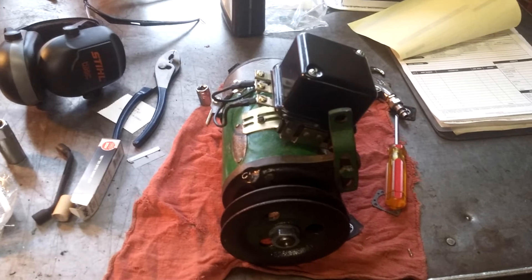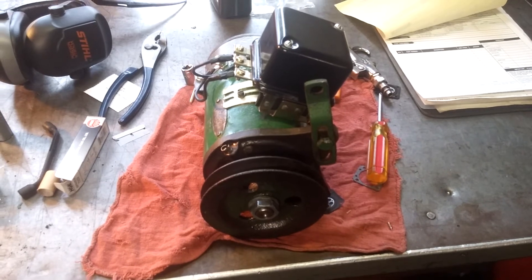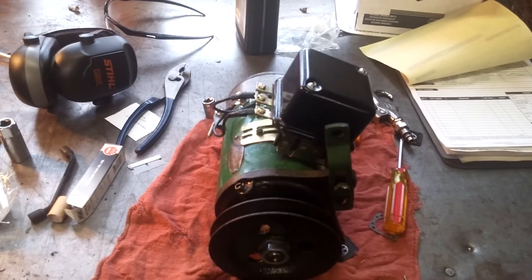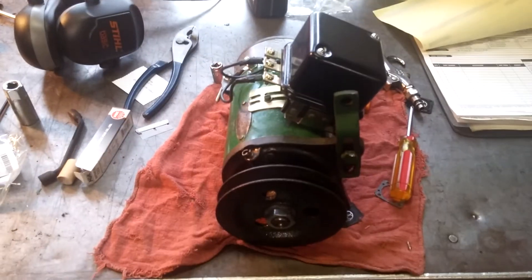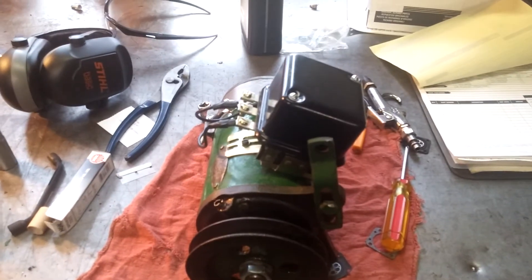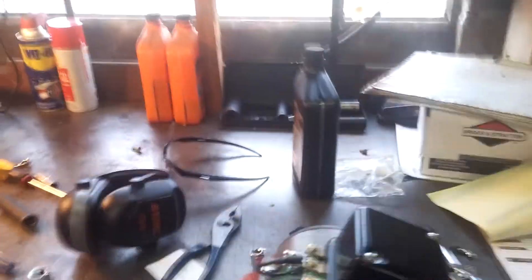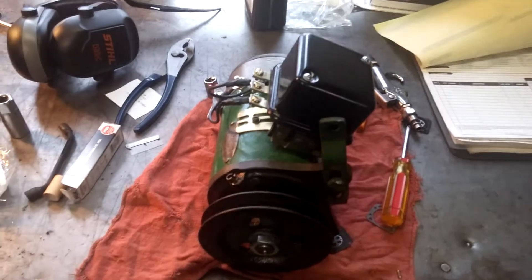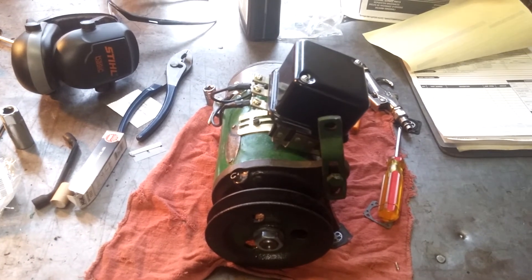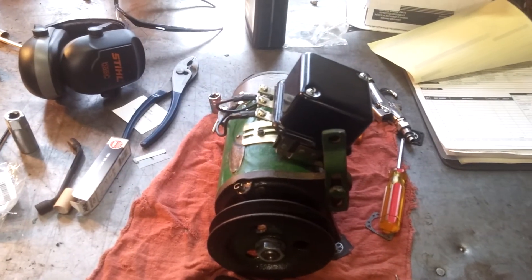I had started out running this thing negative ground and it was doing okay. But I think I'm going to stick with positive ground because that's the way these things were made. I've got to minimize my problems here because I don't know what's going on. I'm really worried that I fried it. So hopefully it's just a quick adjustment in the regulator and we'll see if it's charging. I can't do it here, this is just a lawnmower shop. So I'm going to take it back up to them and make sure that the voltage output is anywhere between 13 and 14 volts, which is what it needs to be. Thanks for watching.